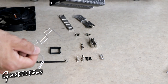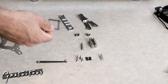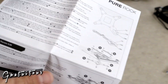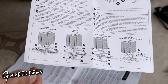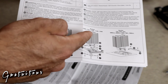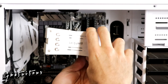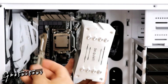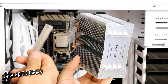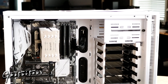Now installing the CPU cooler. The screws attach the fan to the heatsink using O-rings. The instructions specify using the LGA 1151 backplate — my processor is LGA 1151, so I follow the correct instructions. There are different socket sizes like 2011, 775, and 1151. I orient the heatsink the way I want and mount the brackets accordingly.